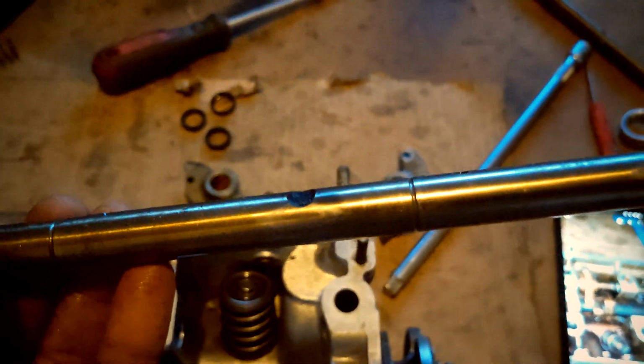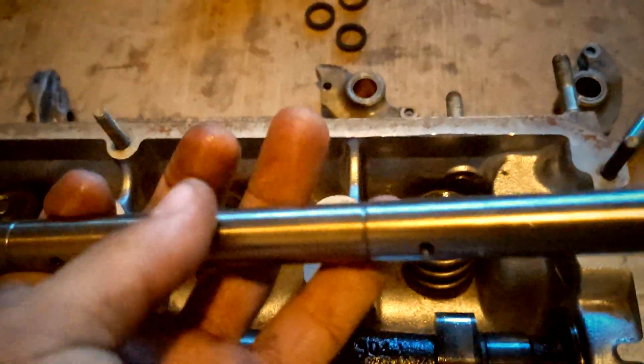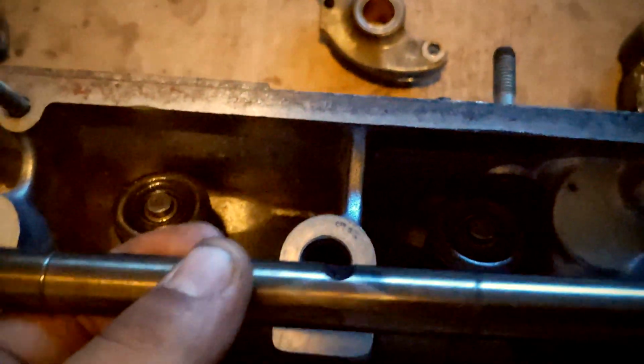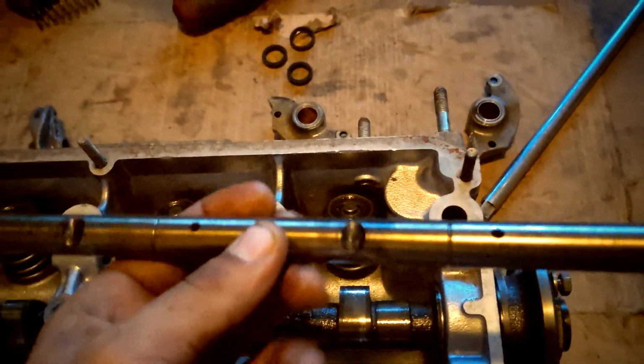And there are these grooves here because on the M30s these are all very specific to each side. This groove here is so that the head bolt will have room to fit. That's why you want to make sure you have it turned the right way when you install it, because it's kind of difficult to turn once you have it inside the head.